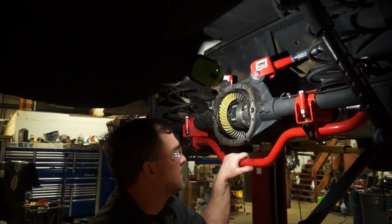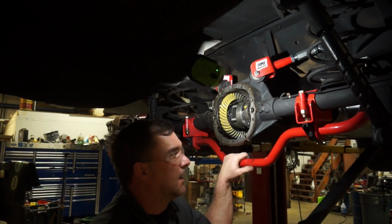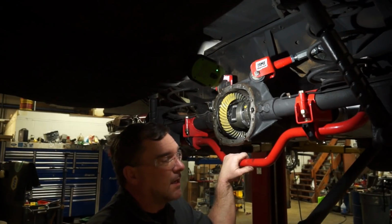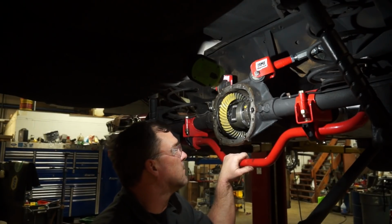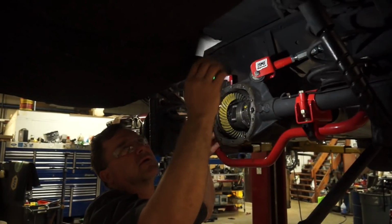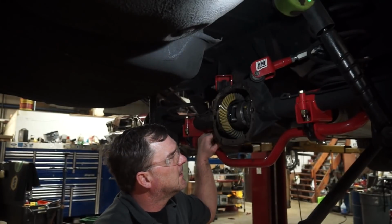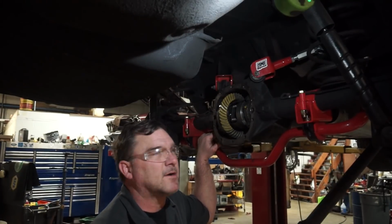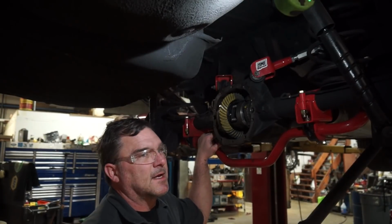So my hands are sore. I'm tired. It's 6 o'clock, and I'm gonna go home because I can't keep beating my head against the wall. I'm gonna have to do some research and figure out what's going on. I don't know if maybe I got a bad ring and pinion set, or I'm doing something completely wrong. I'm going to walk away from it, and I'll come back to it another day, because sometimes these things fight you. That's all you can really do, is walk away, come back with a fresh head, and get back after it. My backlash is anywhere from 5 to 9 thou every time I'm setting it up. Everything's where it needs to be, but I can't get that pattern to come into play.